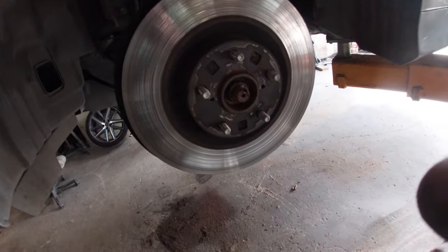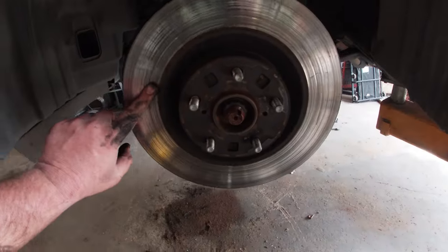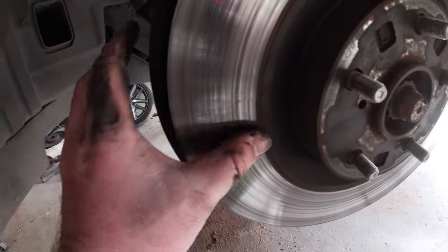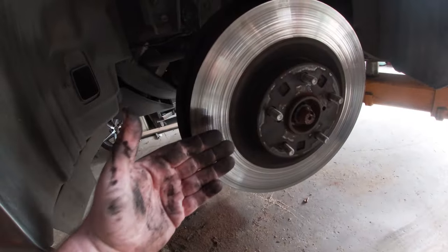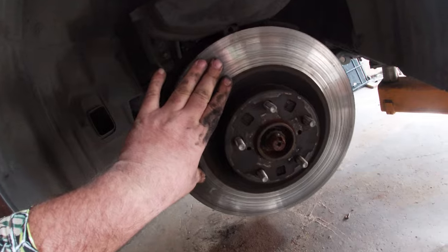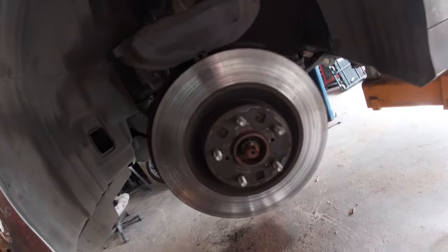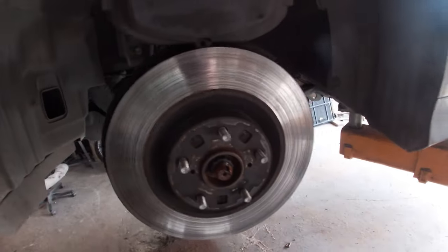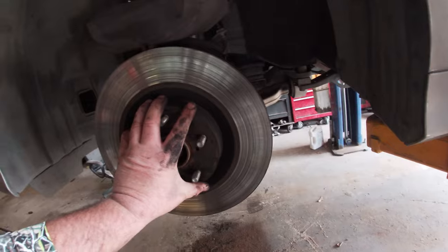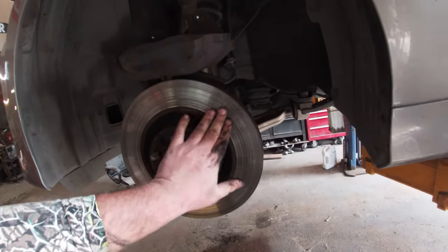This is something a lot of people will tell you — check your rotors. Obviously yours most likely will not look like this. Just feel them for any lips or ridges. I say turn them every time. You can't tell if there's a slight imperfection in the wear, and if it's not perfectly flat, once you put new pads in, a little groove is just going to amplify over time. Just go ahead and take it up and get them turned — any auto parts store will do it, or a machine shop. Maybe $20 a rotor. Get them turned; start fresh with a nice smooth surface for your new pads.